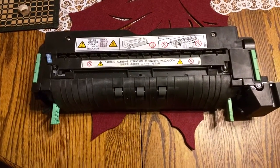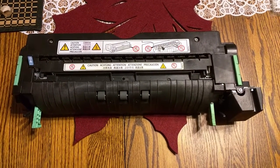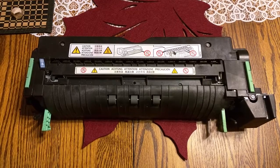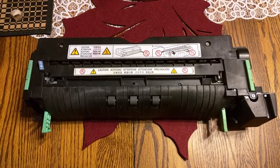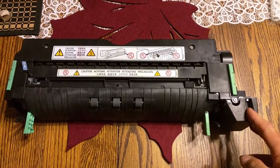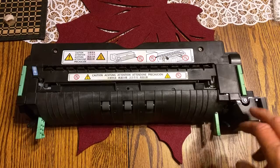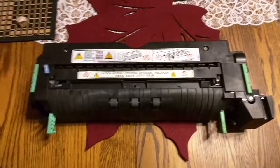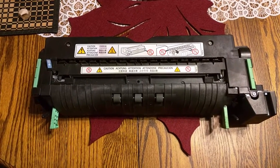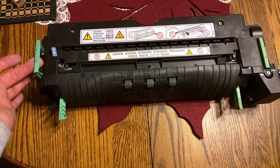Here's a video on how to modify a printer fuser out of an SPC-811DN to go into your Ricoh MPC-3500/4500. Essentially, they're the same fuser section. All Ricoh did was move two wires behind a panel so that if you buy an 811, it won't work. But this is definitely the way to go — it will save you at least $200 versus buying the one for the copier. You can always tell the one for the printer because it's going to have green handles on it instead of blue.